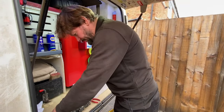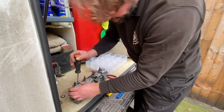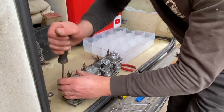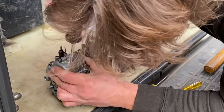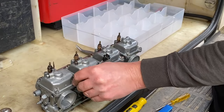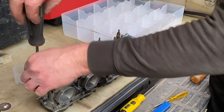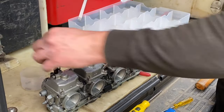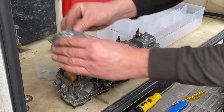So now we're going to start getting off the four screws for the float bowl. You need a really good fitting screwdriver. If the carbs have never been apart before, these screws can be very tight, so just be warned.